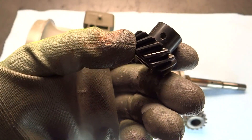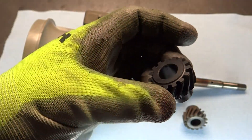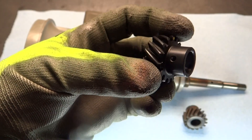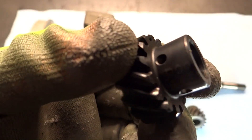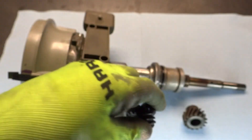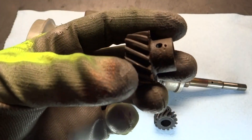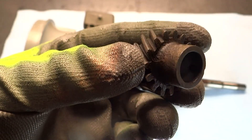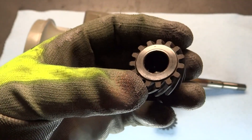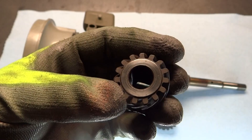So what I did was I went to Summit and I ordered this gear. I'll show you the part number for it. I bought that distributor gear from them, and in the description they had for this gear, it was intended for use with most factory roller cams. I would say that includes the roller cam I have here. You can kind of see the finish on it — it looks like something you'd see machined out of steel. So let's have a look at the gear I took off of this distributor.